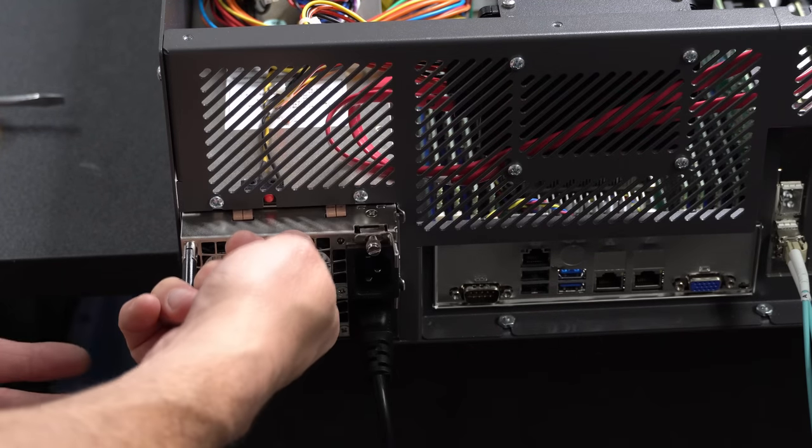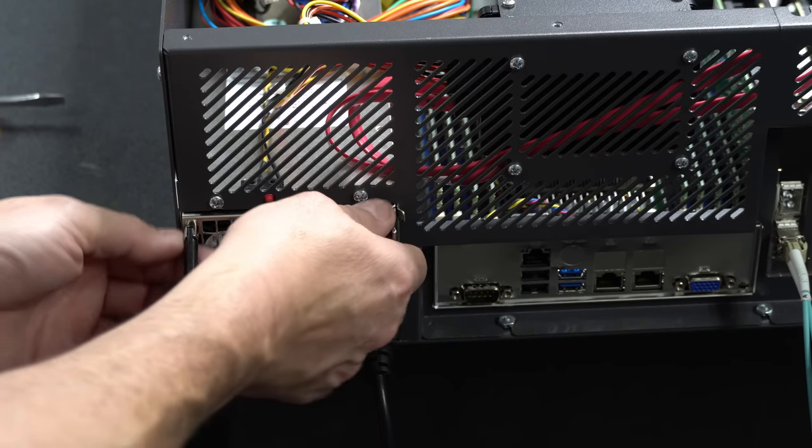And if for some reason the server were to have a failure, it does have redundant power supplies, as you may have watched in the video on that, but it doesn't have redundant motherboards or some of the high availability features, because that's not necessary for what they're doing. They have all this data that comes out of their lab. Then they have a series of compute modules, essentially a whole bunch of computers that are all connected at 10 gig to it to process said data sets.